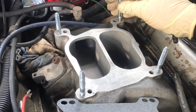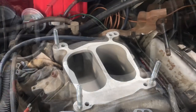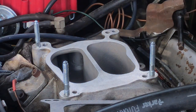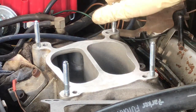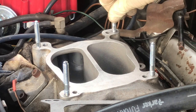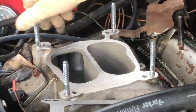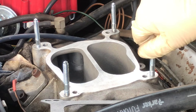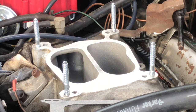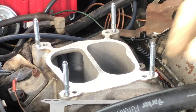Nothing's ever easy for me. I guess those threads are screwed up now. Let's get the tap and die set. Both tapped. These got all screwed up too, because what happened is the bottom of this hole must not have been cleaned out all the way. So when I went down all the way with this, it really got messed up. But I don't think I'm even going to be able to go that far anymore — these are not long enough. They're going to have to be like this right here. Two inches — let's see what we got when we go back together.